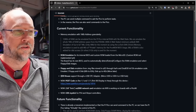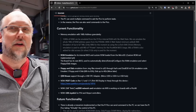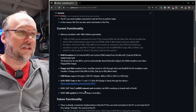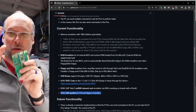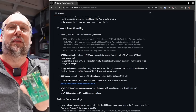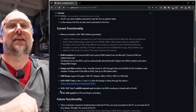It also gives you USB mouse support. With the Raspberry Pi Pico there's a USB port, and with a USB on-the-go connector to a regular USB-A jack, you can plug a USB mouse in so you don't need to find an old serial mouse. Along those same lines, we also get USB joystick support — currently X-input-style controllers and PlayStation 4 controllers, so you can plug an Xbox 360 controller in and have it work in DOS games. Also in beta is network card emulation, so you can get your old PC XT online over Wi-Fi with this card — I've tested it and it works.